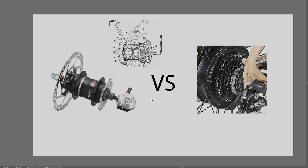When it comes to Bafang mid-drive conversion kits, the same rules apply. You're going to have an easier time getting bigger gear ranges and better hill climbing capabilities with cassettes and derailleurs. With internal gear hubs you'll have worse hill climbing capability and less top speed, but slightly better reliability with less need for adjustment.